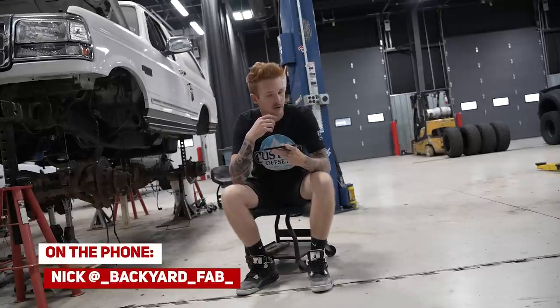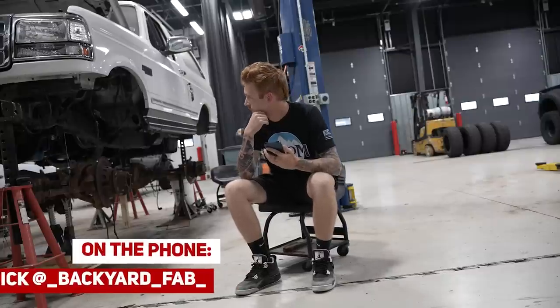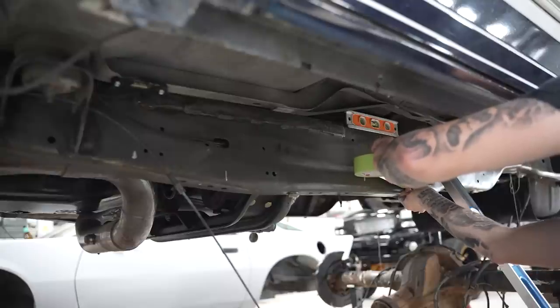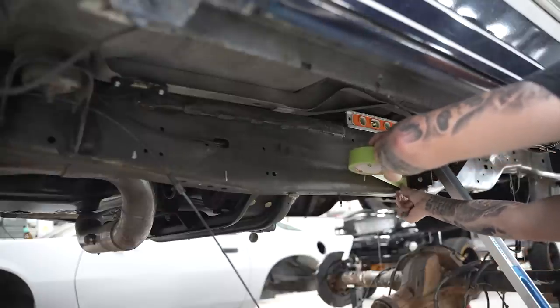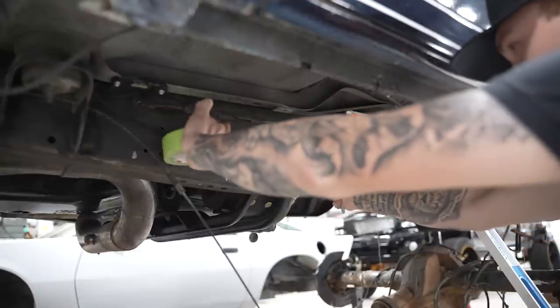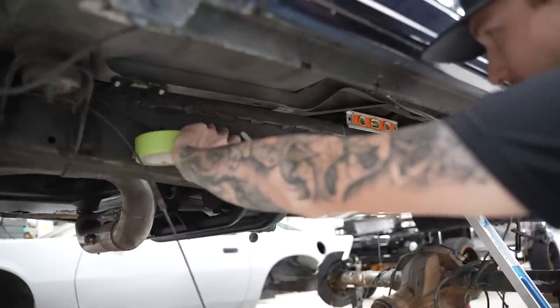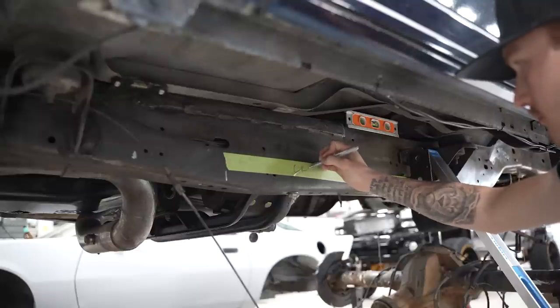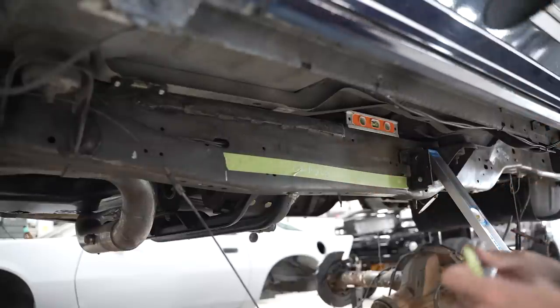So based on the pictures that you sent me about the cradle placement, if you're gonna push it that far forward, I would say with having your wheelbase be so short, I would probably center it in the wheelbase. Just aesthetically, it's going to look the best, with the front links 15 inches shorter than the rear, give or take a little bit. It's going to look way better to actually center them. You're going to be able to see quite a bit of that difference.